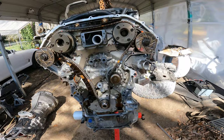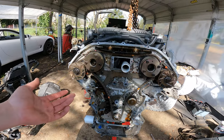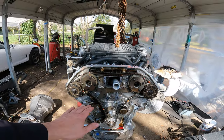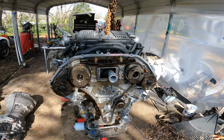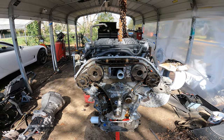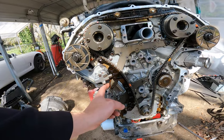I'm going to try to sneak it past that without having to remove the gear, but I'm not sure if I'm going to be able to. That's pretty crappy of Nissan to do that. Anyway, I'm going to have to put this thing back in time — reset everything and put it back in time, but I'm going to try to cheat it. I'm going to go ahead and get the gallery gasket, get this plate out, and disassemble it a little bit more. But you can see where the gasket is blown out right here.